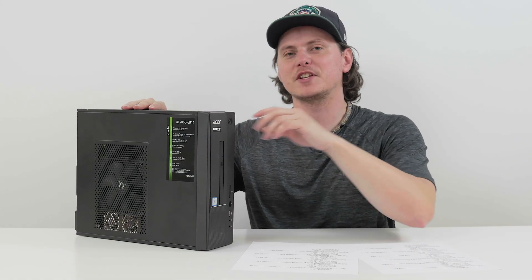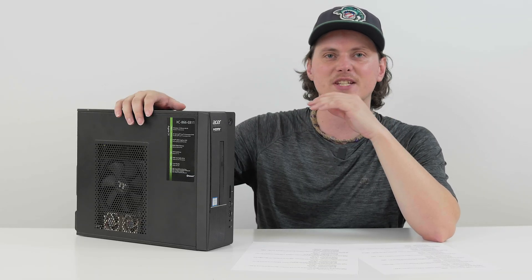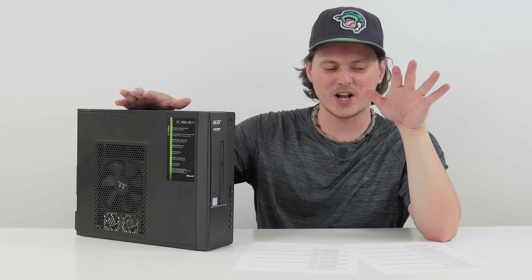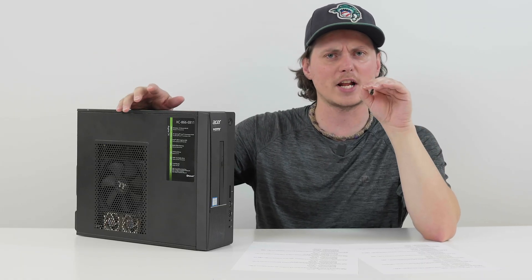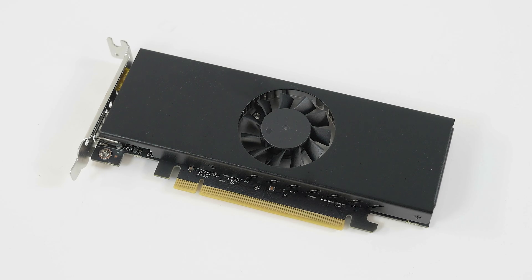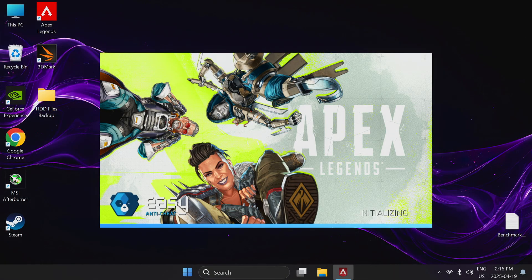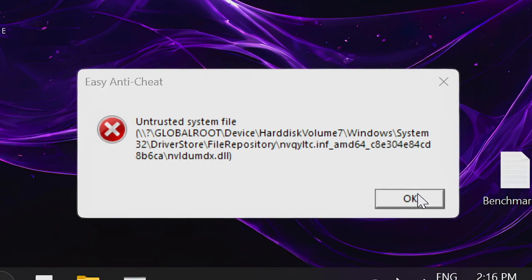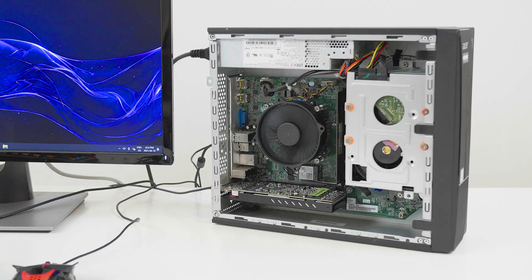That wraps up all the gaming benchmarks for this Acer Aspire XC866 that we made a little gaming beast out of. I made this for a co-worker who was looking to run The Sims 4 mostly, so it'll definitely handle that no problem. I really wanted to stress test it with heavy games like Doom Eternal, Avowed, Atomfall, Ratchet & Clank Rift Apart, and Hogwarts Legacy to push it to its max. I'm really impressed with the performance from this RTX 3050 mobile Frankenstein GPU. The only problem is you do need a modded driver, so Easy Anti-Cheat will throw an error — you won't be able to play games like Apex Legends. Other than that, it's a really good capable gaming machine.